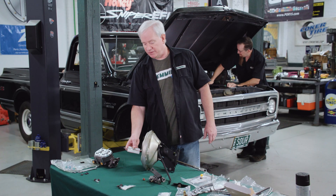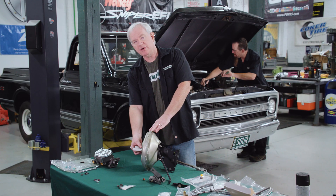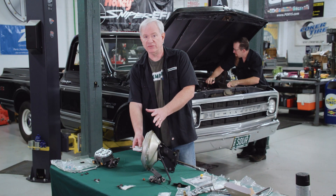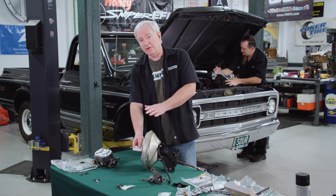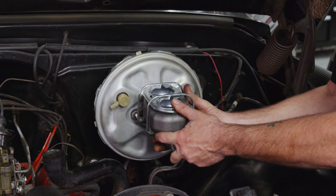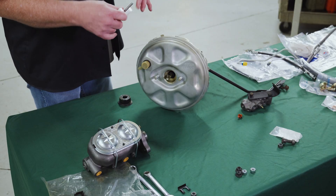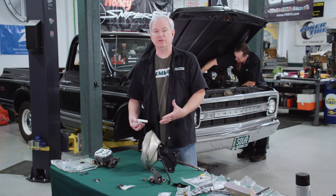The importance of this is that when you put these two together, you want to make sure that the push rod coming out of the booster is not pushing the master cylinder's piston in too far. It really shouldn't be pushing it at all when they're at rest. But we discovered on this truck that when the two go together, there is a little bit of compression going on inside the master cylinder. The problem that can happen is if this rod is pushing on that master cylinder piston too much — particularly when some heat gets in the system — it may not relieve the pressure when you take your foot off the brake, and the brakes may start to drag.